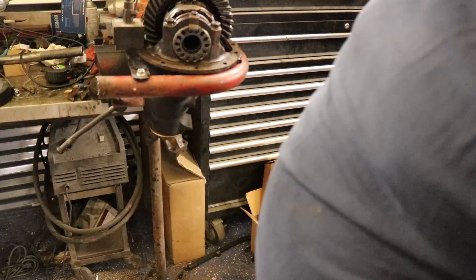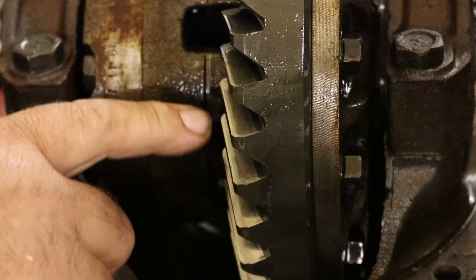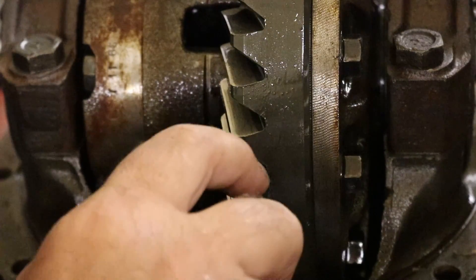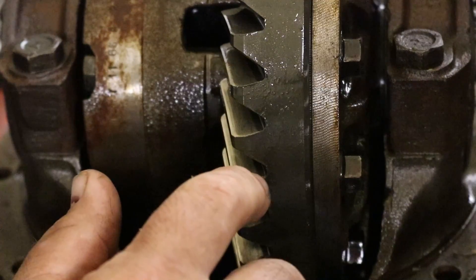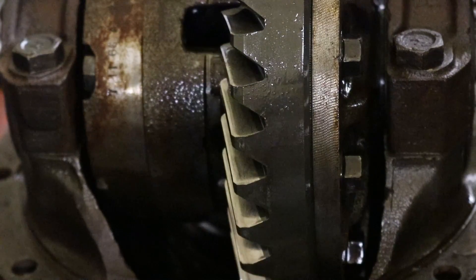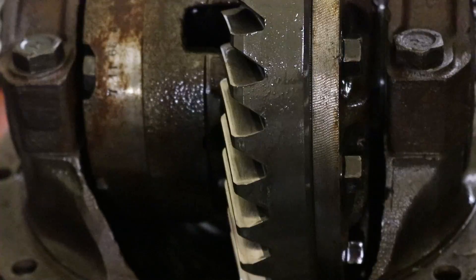As you can see, the pattern is all the way across the gear, and it's going all the way down — just a little bit over three-quarters of the gear. There's just a little black stripe there that's not hitting yet. As the gear wears it goes in deeper, so that should be about right — I'm getting full contact. So I don't know why this gear was raising hell; we'll find out when I put it back in.